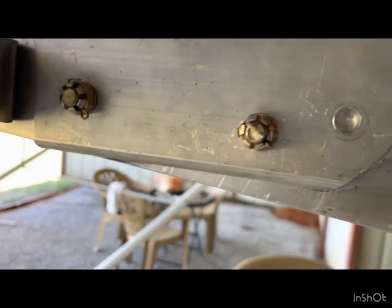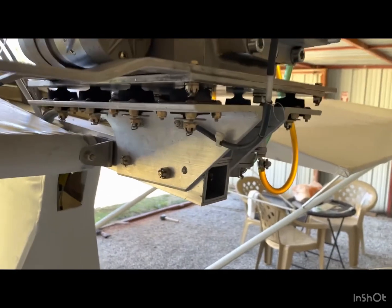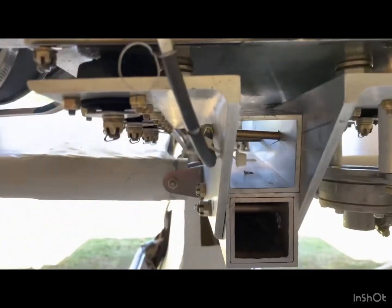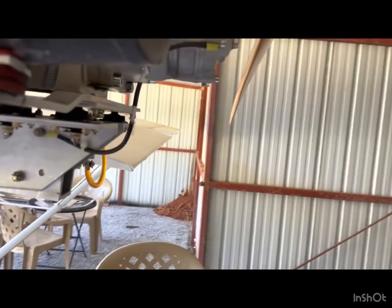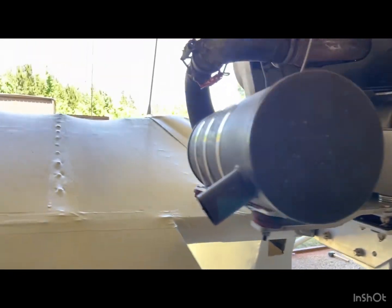It's done. Pulled about three-quarters to an inch ahead and through the root tube. That top bolt was already crooked — that wasn't me — I just drilled through. Once you turn the spacer tube half a turn, you can see the old holes on top and the new angle along the root tube. The engine thrust is now more parallel to the ground. Let's see how she flies — four mile-an-hour winds out there, I'm excited.